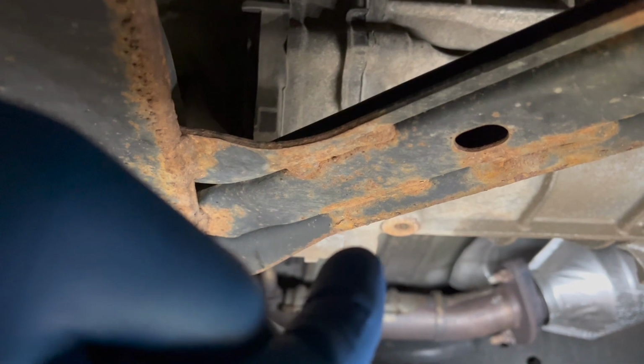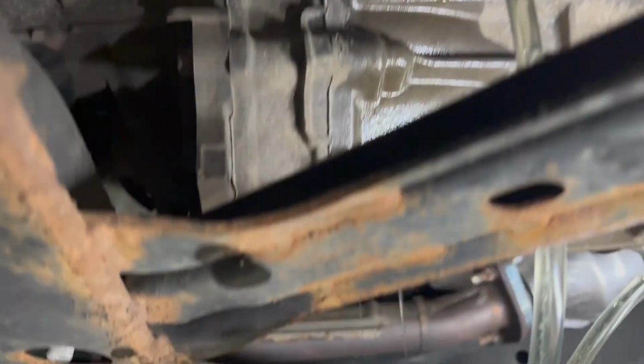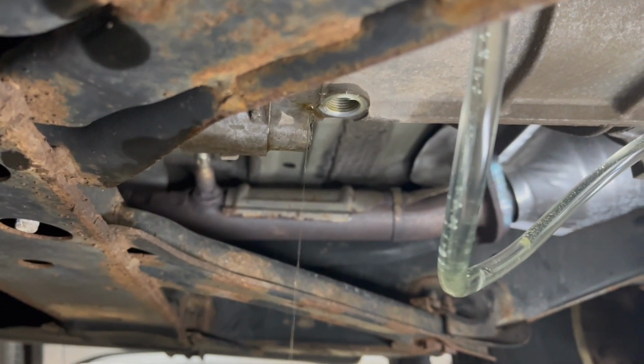That is pretty murky looking fluid, but holy smokes, look at all these chunks. I've got metallic gear oil, probably not something you want to see, so you are going to be in a world of hurt. Change your fluids. Good to put the jugs, oops, looks like I'm flushing the system now. I forgot to put the drain plug.